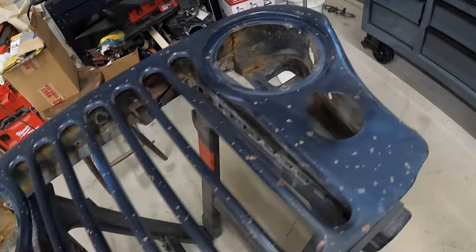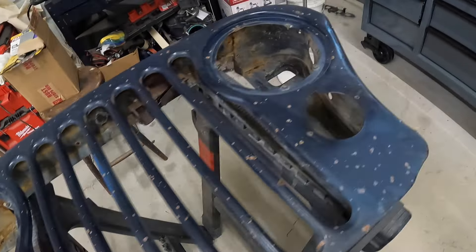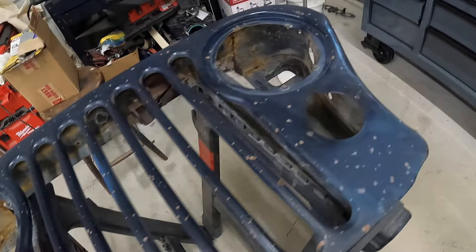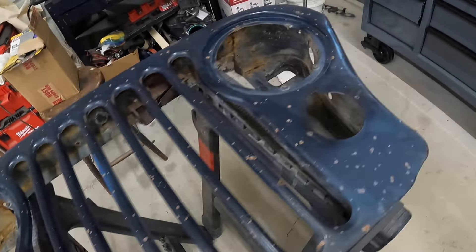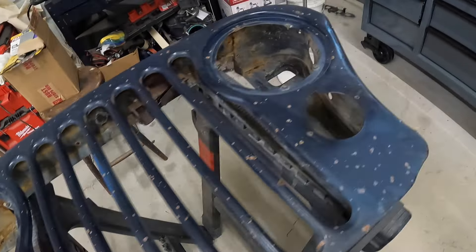This thing looks amazing. I'm glad I took that extra step — and that's basically what they call color sanding or wet sanding. Take a flat sanding pad, some paper. I bought sheets of sanding paper off Amazon — it's got 120 through 3,000 grit. I did a first sand of 1,000-grit sandpaper, then went over it with 2,000. Then I polished it out with some compound and my wheel. Does it look awesome. The best thing is I didn't do that great of a job — there's a low spot here and there — but what's perfect about that is it matches the rest of the Jeep.